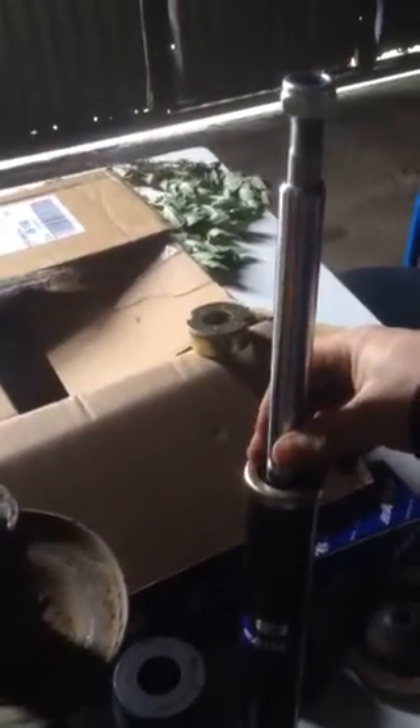So here we have the whole strut pulled all the way out, so the piston is all the way up, and just by putting my finger here at the side, I can actually feel the piston retracting very, very slowly back in. There's actually oil inside this and it's under a tiny bit of pressure — just a little bit of air pressure inside it, and it's sealed. So when you pull it up, it slowly, slowly wants to retract all the way back in. You can see it's actually getting shorter all the time, one versus the other.